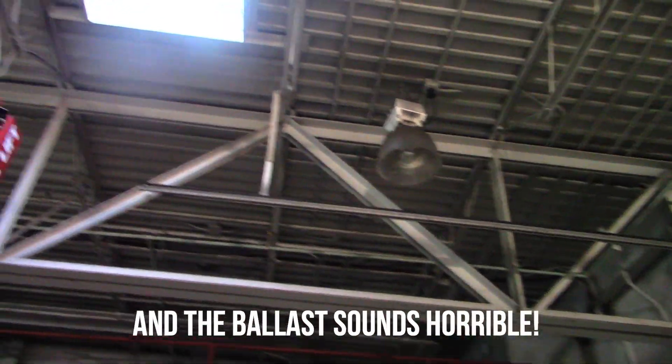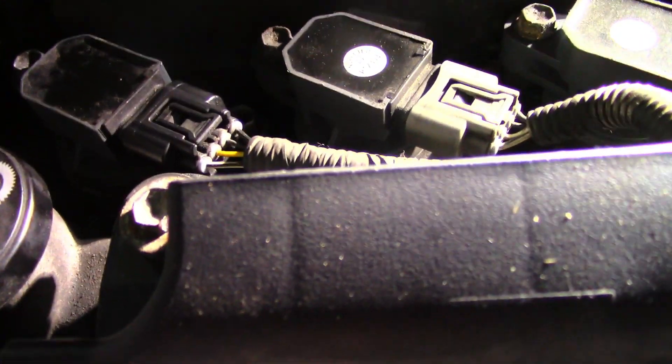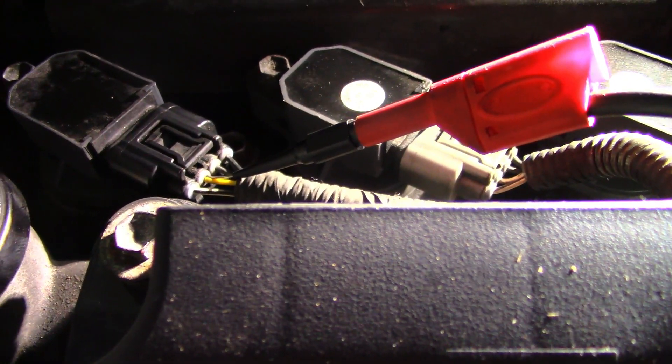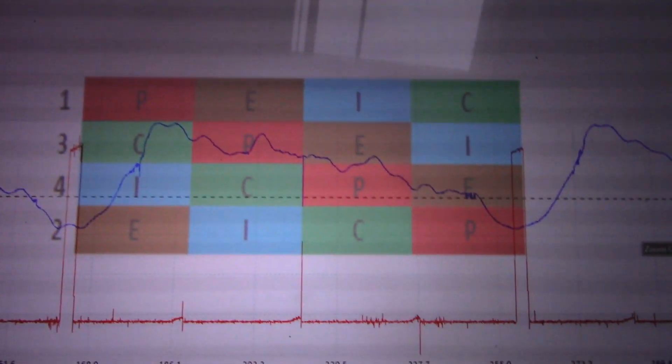I have a burnout light so this video might be dark. The other ignition coils are pretty easy — you just pick the wire that is different from the other four. Cylinder one has a yellow wire that's different from the other coils; that's going to be my trigger wire from the ECM. I'm going to fire this up and grab a waveform. I'm using a one PSI scale for my exhaust pulse on the blue trace and a ten volt scale for my ignition trigger on the red trace.